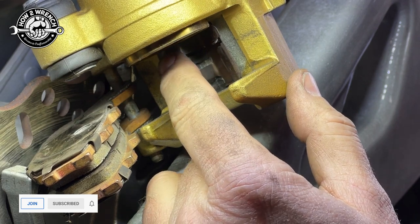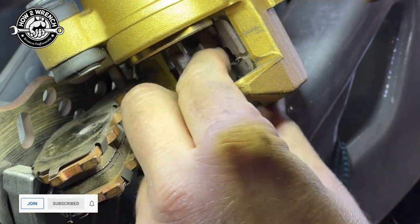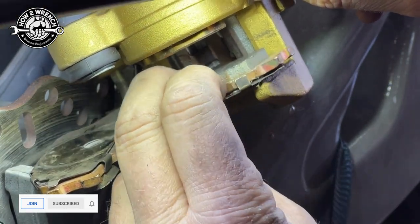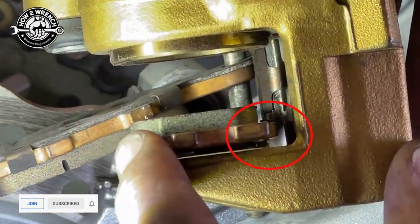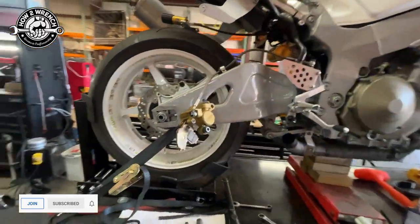What happened was the bike just kept getting noisier, and by the time they got back to the mechanic, apparently he didn't want to take any claim to it. What it did was ruin this clip — it bent these little tabs over. So when you look at anything like this — doesn't matter if it's a Honda, Harley, Suzuki, Kawasaki — brakes are brakes. This little spring retainer needs to sit in there in such a way that one pad stays stationary and the other has the ability to slide all the way across. When it's in there correctly, that little ear just puts a little bit of pressure on the pad and holds it right in place.